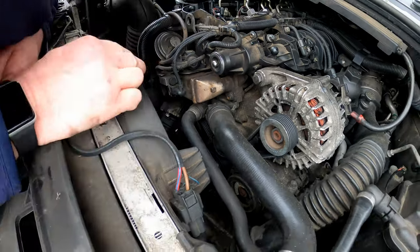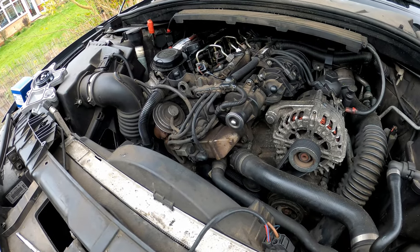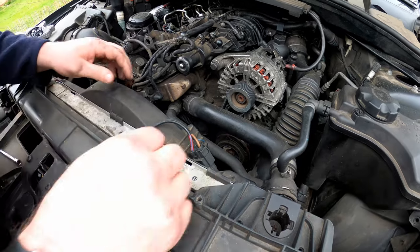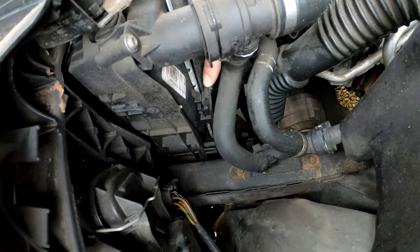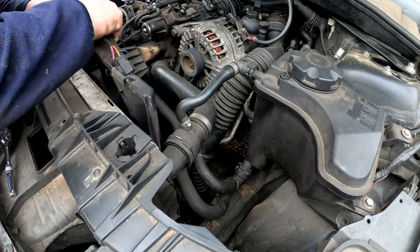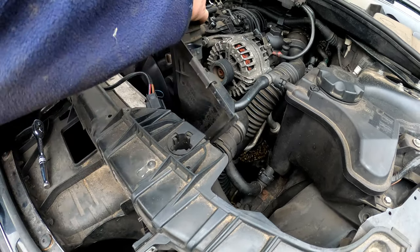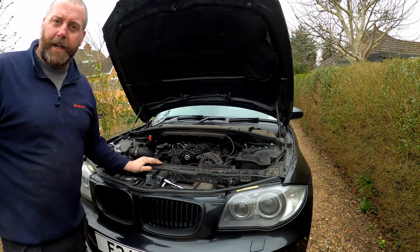What I'm going to do next is remove this fan. It comes off pretty easily — there's a Torx bolt up in this corner, I think that's the only one, and it's a T20. There are a couple of sprung little tabs just here. You can see this little tab that I'm springing backwards and forwards — that allows the whole fan assembly to come up like so. We do need to disconnect the electrical connector, like so, and then the whole thing comes out. Pretty simple, really.